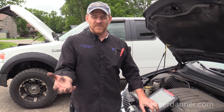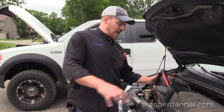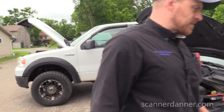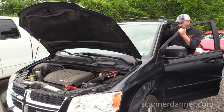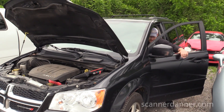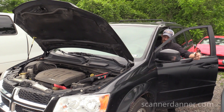Customer complaint is a misfire. I haven't pulled the codes yet. What I did do off camera is a real quick sound test for cranking compression. I want you guys to listen to that. I have everything set up to do a relative compression test. But listen to the way this thing cranks. I'm just going to do a pedal to the floor, clear flood crank. Technically it might not be clear flood — with the pedal to the floor on a system like this that's drive-by-wire, it kind of automatically does default stuff. So take a listen.